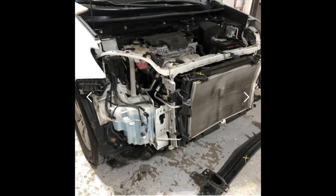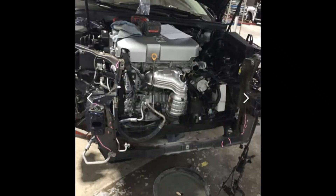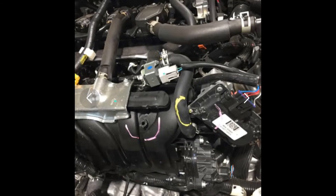You will also notice here that when the radiator and condenser are removed, the fluids — the coolants and antifreeze — need to be drained in order not to make a big mess once you have removed them. That's why you have a drain pan below to do just that. Here is damage to an intake manifold, which connects to the engine assembly, and you also have to notice that these hoses can be pinched and/or punctured and may also need replacement.